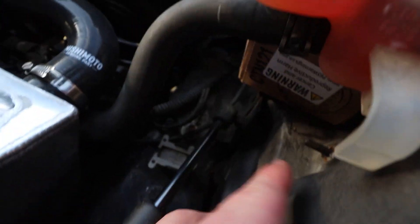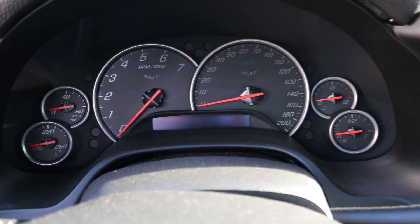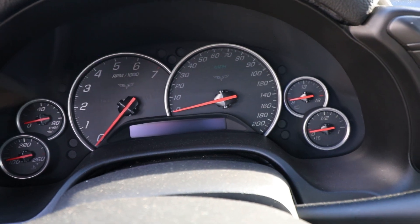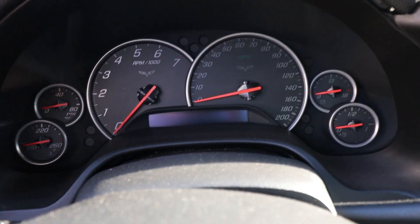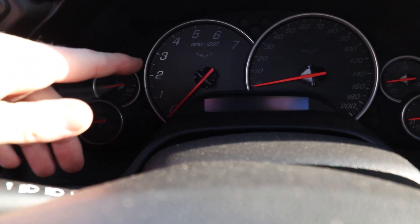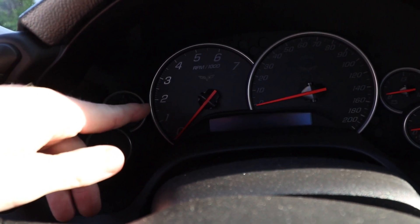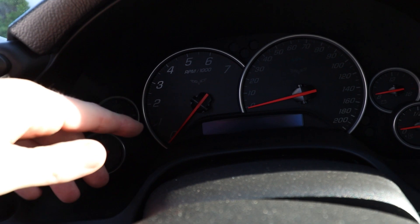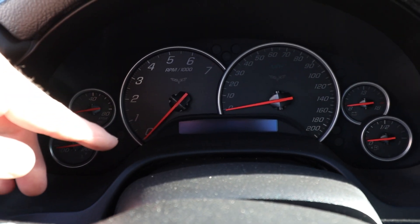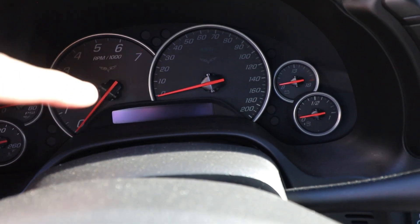To achieve this there's a 10mm nut right there and one right there, and it just slides right out. I forgot to mention: I have the coolant just below the full cold line — I don't want too much coolant in there so that when I go to burp it, it doesn't come spilling out like it did earlier. Start it up and idle it between 2500 and 3000 RPMs back and forth, or just keep it at 3000, for about 30 seconds. Let off, let it idle for 30 seconds, then bring it back up — continue doing that until the coolant hits about 210°F, then shut it off.